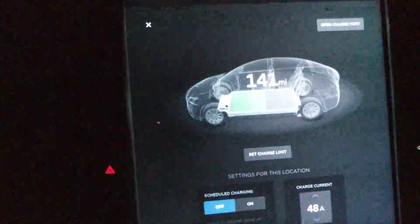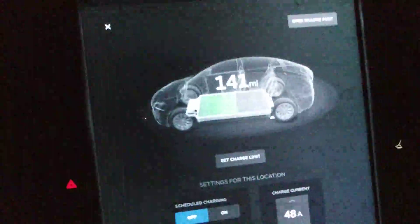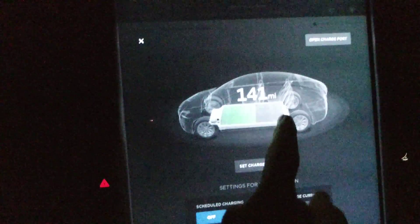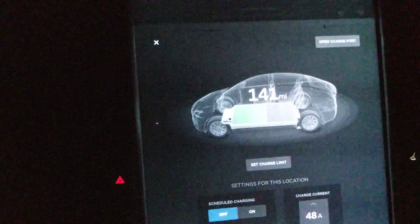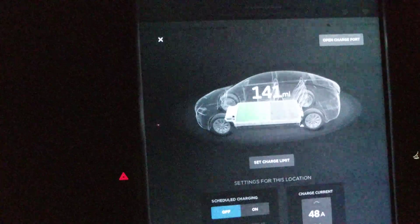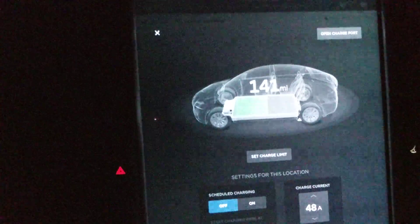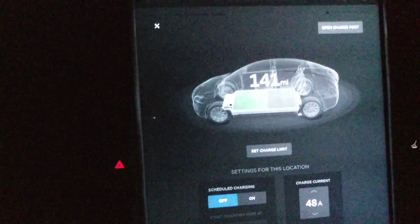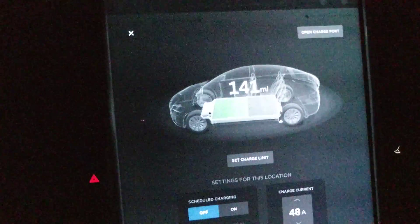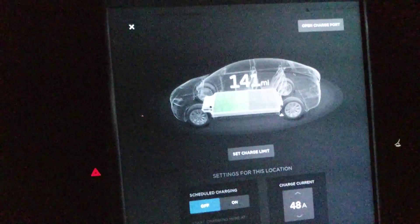On the last stop of your trip, I want to fill it all the way up before I get to my destination so I don't have to run out and charge again. I'll usually go to 100 percent at the last stop. I still have to drive maybe 20 or 30 miles from the supercharger to my destination, so I charge up to 100 percent and then drive away immediately without waiting.